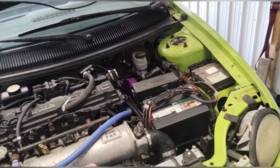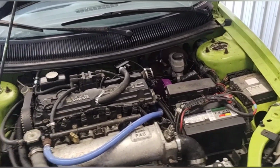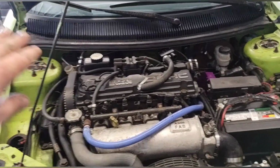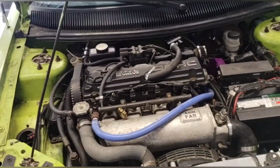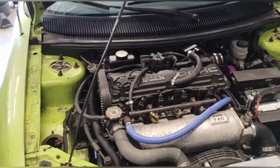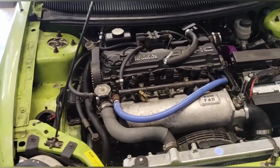Your single cam transmission fits your dual cam. You don't need to buy a different transmission. Clutch, flywheel, everything fits. For these 2.4s, you need to buy a 95 to 99 Cloud Car. Your minivan, your Chrysler Cirrus, your Sebring, that's how you get one of these 2.4s. That is plug and play. The newer ones are not plug and play. Different ECU style, different crank sensor style.